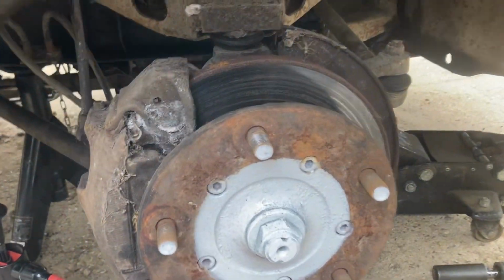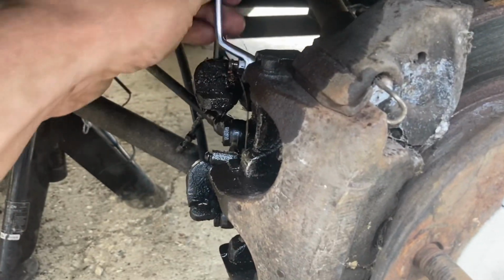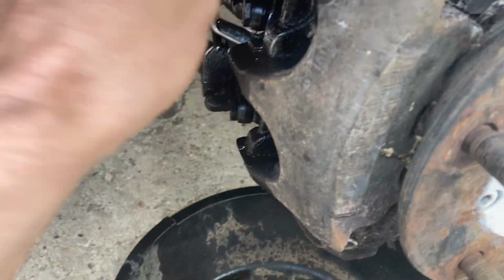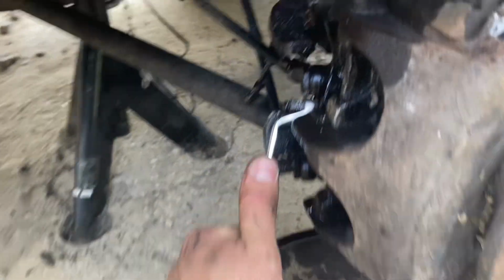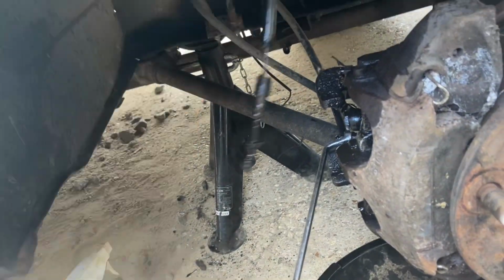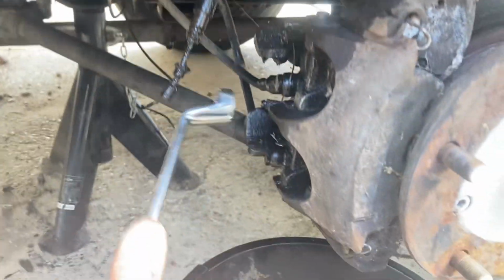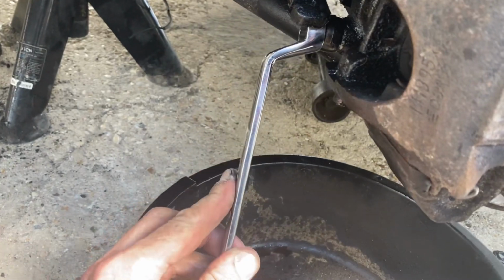The owner of Ned had mentioned that when you brake, it pulls quite sharply to one side. So investigated that, and one of the calipers pretty seized up and can't free off the piston, so decided to remove them and rebuild them. So got new piston kits and seals to go in.